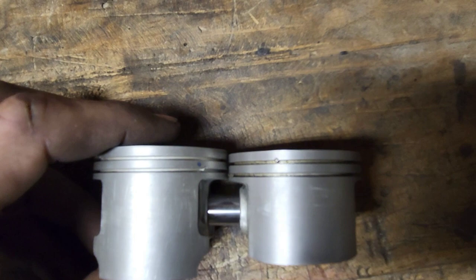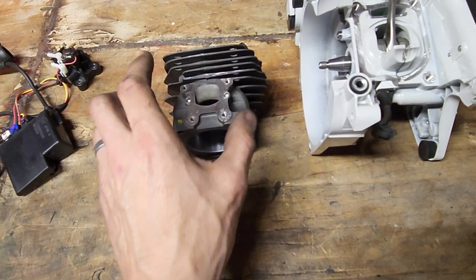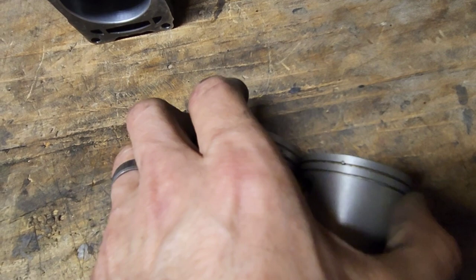So you're higher on your top. I call this the corner of the piston. You're higher on the top. You have a narrower skirt, so you've got to be damn careful. Put it this way, you are barely wide enough for your intake and exhaust. So just a word of advice, I would not widen your intake or your exhaust if you do this build. But you're longer on your skirt, and you can do some creative machining because you're taller.